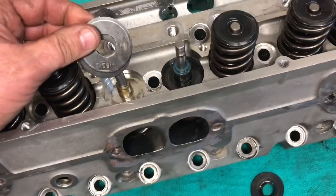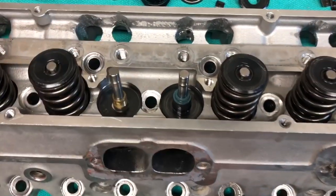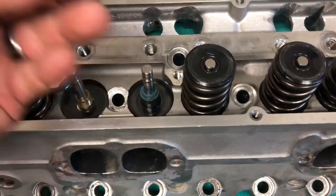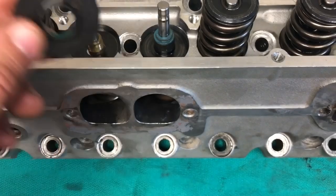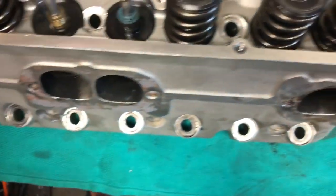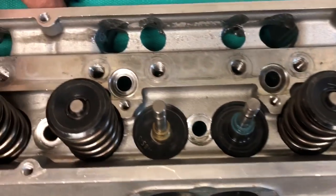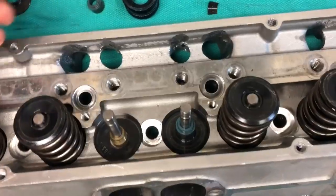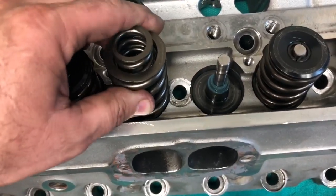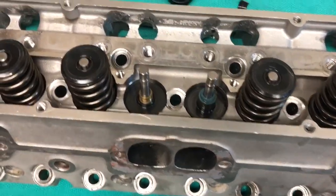I got another shim — another 30-thou. We needed 25, I found a 30, so that's going to work. We're going to stick that back on. Both of the hardened shims go on, then the spring cup locator — that's what this thing's called, and it's hardened steel designed to protect the head. You have to be careful because they come in a whole bunch of different sizes — this has to fit in that bottom spring. It's a spring locator: it sits on the head and holds the spring in place. The retainer on top does the same thing with steps in it. The spring will go into the retainer, and it's always better to have it located top and bottom. Otherwise the spring pocket is a little bigger and the spring could dance around, which is why you put this part in.